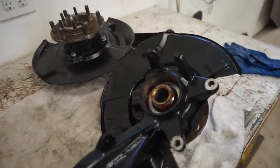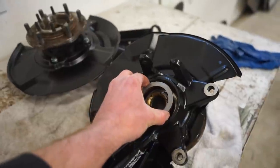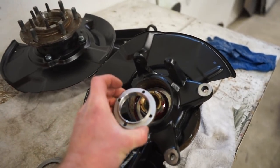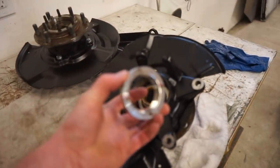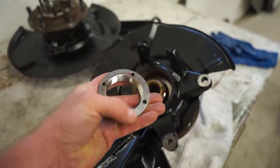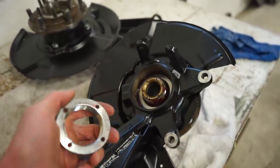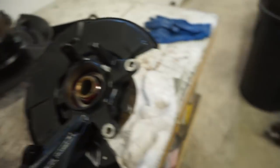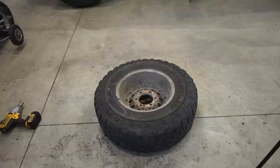All right, it's time to get this rear axle nut on. So before you put the nut on, there's this spacer that goes right down in there. I'm actually going to grease both sides of that, and then I bought new nuts just because I didn't know if I was going to screw them up or not, which they are still good, but I got new ones, so we might as well use them. So I'm also going to grease the threads, a little bit of grease on the threads and grease on this surface here, just so it torques a little bit easier, just so we can make sure we get to the 205 foot-pounds. So that's the torque spec for this, 205. So we'll get both these in there, and then we'll put the whole assembly back in that wheel and tire and see if I can get this to 205 foot-pounds by myself.